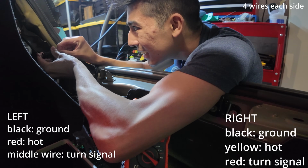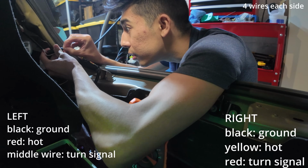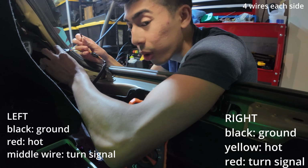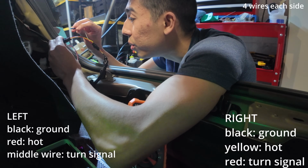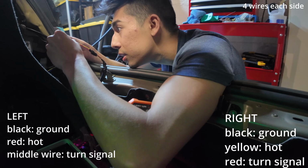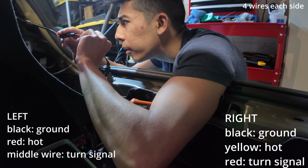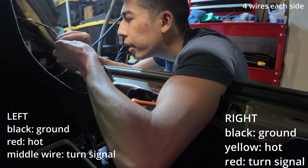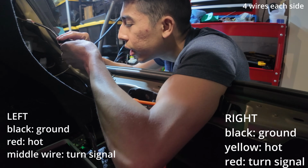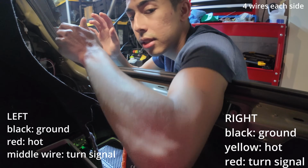Almost. Okay, be seriously careful with these little wires. Don't shove them because you might be shoving them into each other directly, not into the hole. And if you miss the hole, you might bend it. So take your patience and be seriously, seriously careful with these little jumper wires because you don't want to bend anything. But that looks pretty good. All right, so pushing it all the way in, give it a little tug test. All right, so everything seems pretty secure.